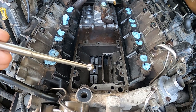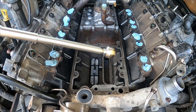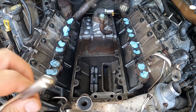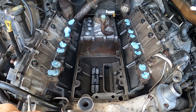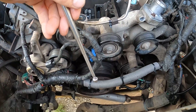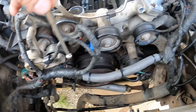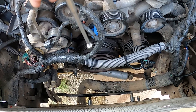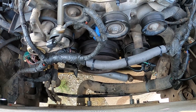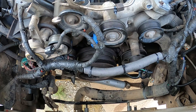I'm waiting for a new screen to come in. I know oil didn't get past the oil filter to the rest of the system. Metal in your oil filter obviously goes through your low-pressure oil pump because all your oil goes through it. I've already put it back together — you can see my dampener down there. I had pulled that off yesterday and pulled the low-pressure oil pump gears, and I have video of that which I'll pop in here.